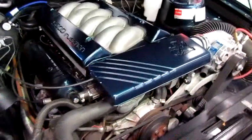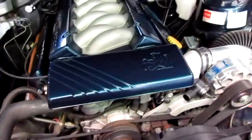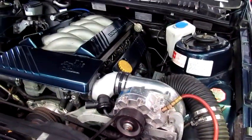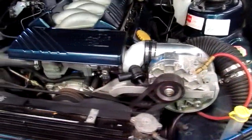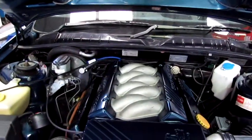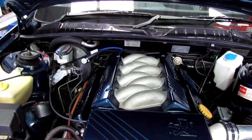We've actually gone through and changed the injectors. We've upsized them a little bit to be able to remove the rising rate fuel pressure regulator. We've put in a different style of fuel pump, one that can stand constant duty rather than just occasional use. And then we've essentially gone through and neatened it up, but set it all up like that. So it's come to a combination which should make a lot more sense.